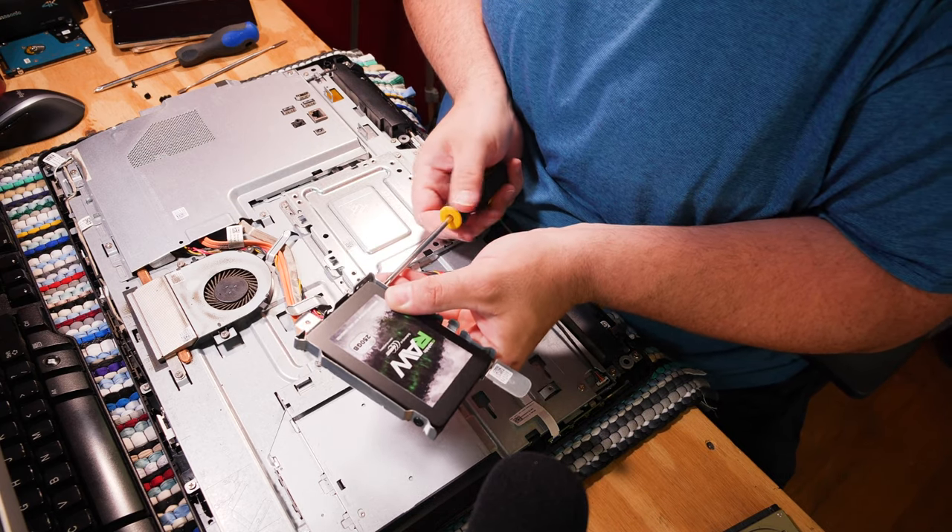It's not snapping down. Well, I did what Dell told me — it takes a lot of force. If you're pushing this thing back together, you need to use a very broad push. Don't put too much force in any one spot — push very broadly so that doesn't damage anything. And if you still can't get the seams to go together, you can squeeze the edges, but be careful — there's always a risk you can damage the LCD doing that. This corner just flat out does not seem to want to — yeah, and as soon as I complained about it, it snapped. Alright, it's good.